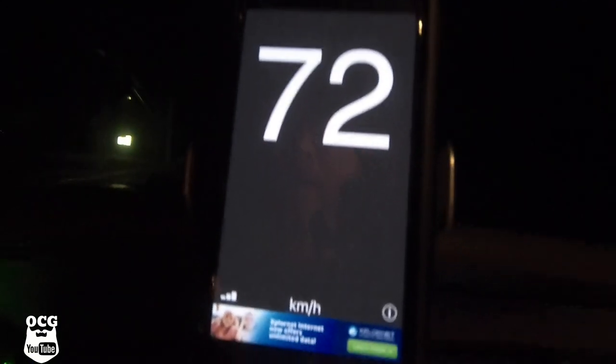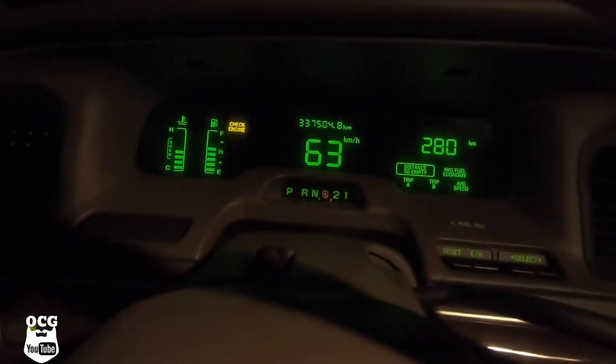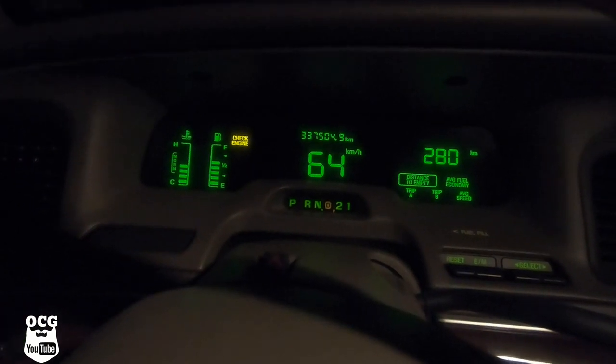Right now, for example, the GPS says we're doing 72 but the car's speedometer says 64 — so the speedometer reads about 10 km/h or roughly 6 mph slow. That's something to keep in mind driving through town. I'm probably not going to worry about it until we change the gears, and then I'll take it to Ford to get it reprogrammed, or get the car Marty-tuned to fix it at that point.